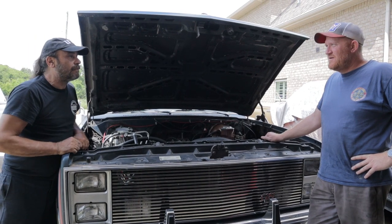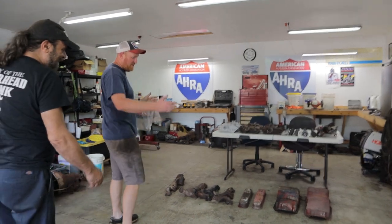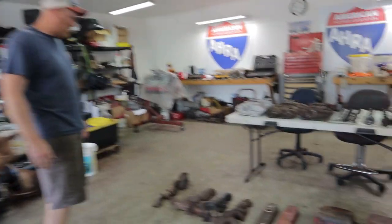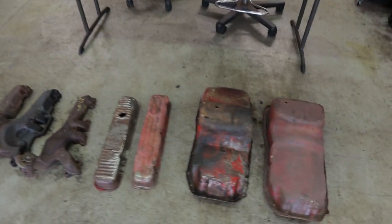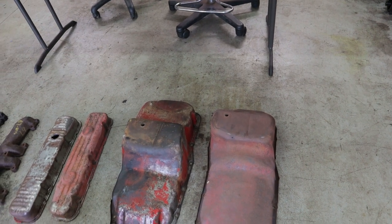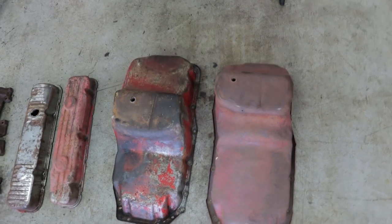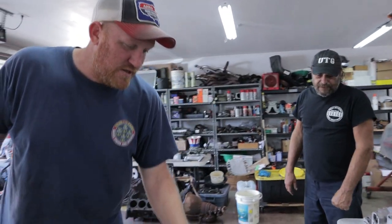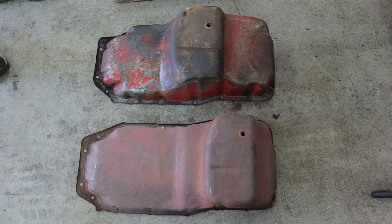Today we've got pretty much everything we need here — it ranges from about five or six different years of stuff. The first thing we should talk about is the pans. On the floor here — in the big block Buick there are two different types of pans: you have a rear sump and a front sump. The only reason the front sump exists is because the Riviera used an X-frame all the way through 1970. Because it's a rear-steer car, they had to move the sump forward, so any big block Buick from '67 to '70 could have come with a front sump pan if it was in a Riviera.